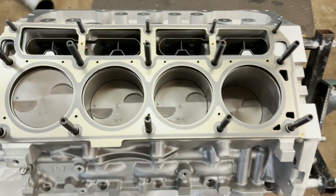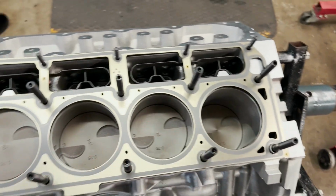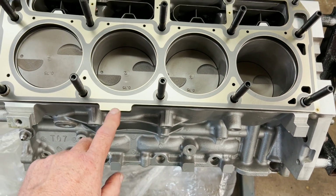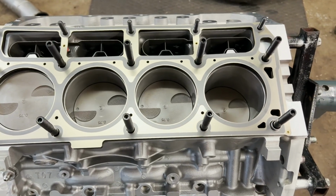All right, so we got our BTR head gaskets on here. One thing's weird about these, they don't say front or nothing like that on them. So you just kind of gotta follow this little tab here. It'd be like the LSA, LS9 gaskets. This tab's to the front of the block,